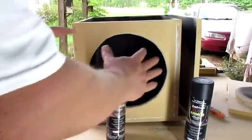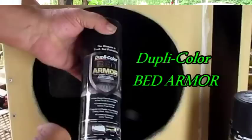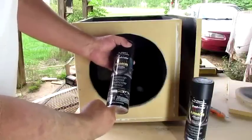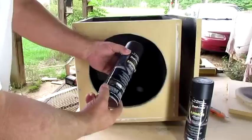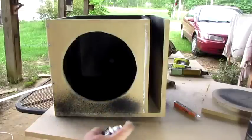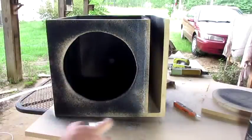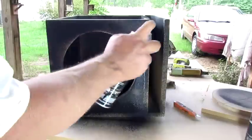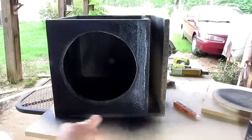I got my hole cut out and I have sanded it up some. I'm going to spray this on the inside and the outside of the box — I'd rather use this than carpet. Now this is bed armor — it ain't a slick finish, y'all know what bed liner stuff is. I got a feeling this right here will do pretty good, I'm fixing to try it. I ain't read no directions, I'm just going to spray some on like I do car paint — put some on and come back and put some more on in a few minutes, whenever it feels like it's dry.